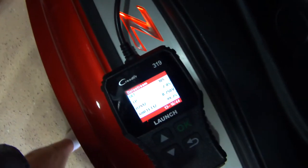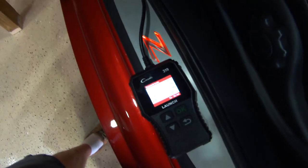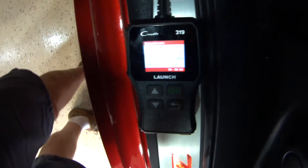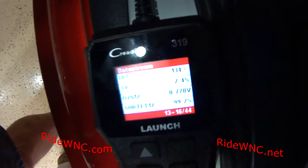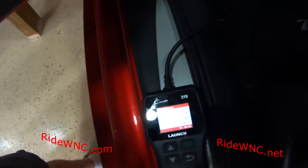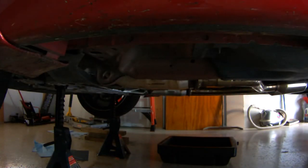The fluid's in the car. This is the little OBD reader that I use — I wish the screen would show up better in the video, but we're grabbing the streaming data off the ECU. Our goal was to get the transmission up to temperature of 140 degrees Fahrenheit. I don't know if you can really see that, but we're at 134 degrees. It took probably about 15 minutes of the car idling for the transmission to get to 134. I'm kind of impatient at this point — 134 is good enough, so I'm going to roll underneath the car and drop out the fluid.